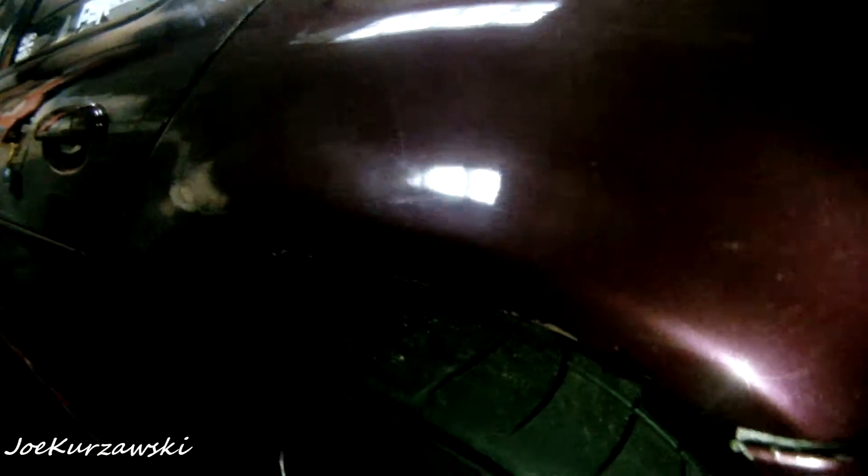So they're maxed out to the highest point. I can drop them two and a half inches from where this is, so that would be like tucking tire. Basically, I can run it where it's at and allow them to settle a little bit before adjusting them lower. After doing a little bit of research, I found that these coils don't really compress too much - they don't settle too much, maybe an eighth to a quarter of an inch. So I'm going to lower them an inch.